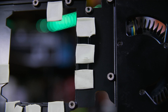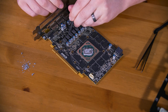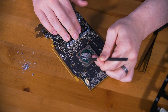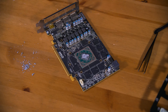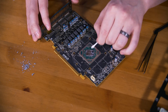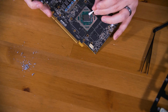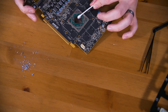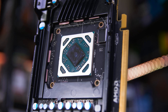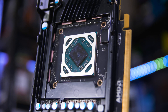For cleaning, the thermal paste is something you want to crack out the isopropyl alcohol for, to gently clean both off of the heatsink itself and much more gently from the GPU die. You'll want this as clean as you can get it, specifically without scratching or damaging either of those surfaces. This might take a little while but your patience will be rewarded later, so take your time and make sure it's thoroughly cleaned but left in good condition at the end.